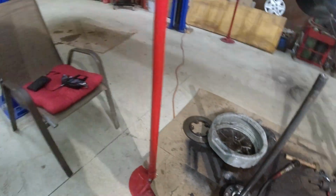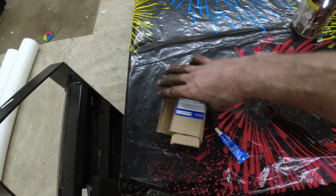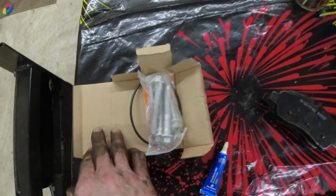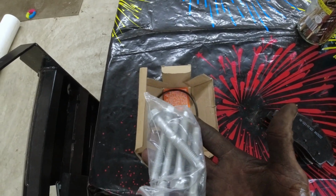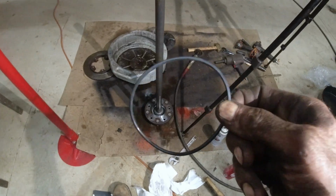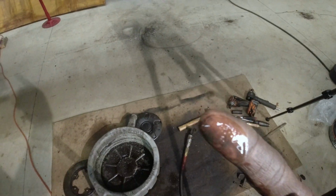Get your new O-ring. O-ring came in a kit. Over here, it's a Dorman. Got it from Napa, not a sponsor. It's a part number. Comes with shiny new bolts. Well, dull new bolts. These are torque to yield. They recommend replacing them. And a new O-ring. You're going to put this on. You're going to want to put some oil on here. You reach inside here, you might find some oil right here.